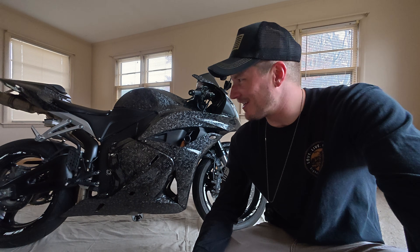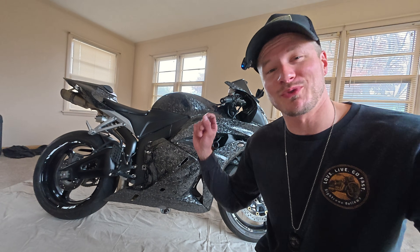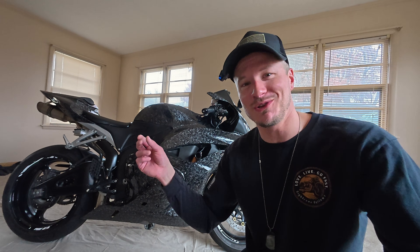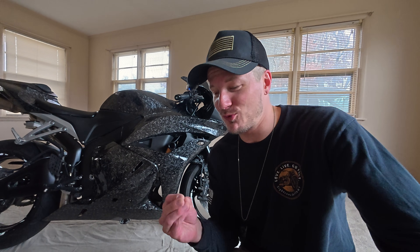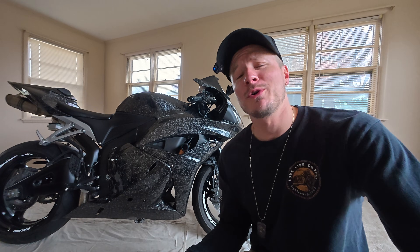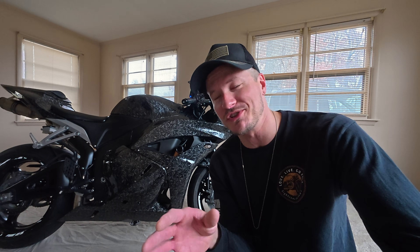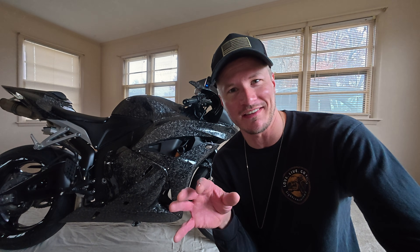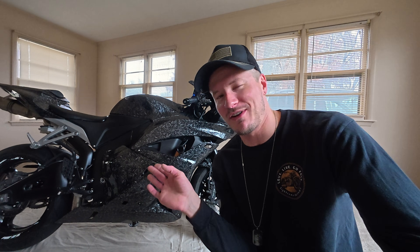Now, why we're doing all this is because I did a kind of custom exhaust system. Our bike is de-catted, I've got a two-inch rear pipe, that link pipe going to our wide open muffler — so it's kind of like the poor man's full exhaust. With that open exhaust, there is power to be gained. Before you get an ECU flash, whether you have a slip-on exhaust or a full exhaust, you're not gaining any power. Depending on the bike and model, you may be losing power because you lost all your back pressure without adjusting your fuel and air levels — all the mapping to optimize your combustion to gain power from those changes.